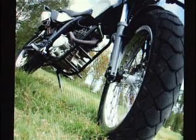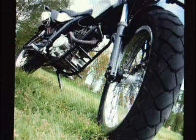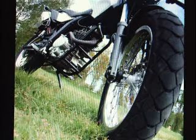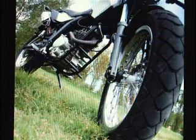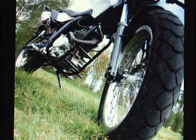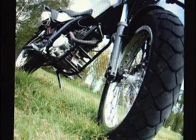A few little things to point out around the bike. All the wheel bearings have been checked okay, but I've noticed there's the smallest amount of up and down play on the rear suspension link, but that's quite normal for a bike that's not been used very much. It amounts to perhaps about half a millimetre. I guess if you had time, you could perhaps oil it to take the slack out of it.